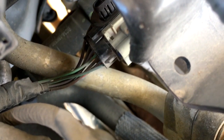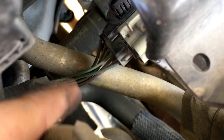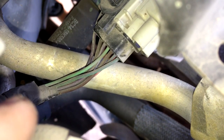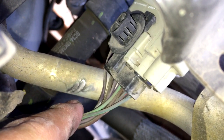The connector we're looking for lives underneath right here. You can see this connector — I'm going to try to get a good shot of it. This is the harness, and there's the AC line right underneath it. I turned my light on so we can see it a little bit better. If you move this harness, you'll see some burn marks right there on the AC line — you can tell where these wires have been shorting out because they're actually laying on the line.